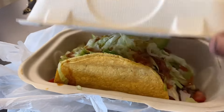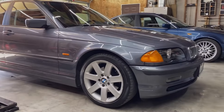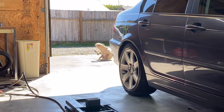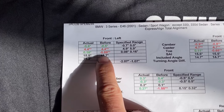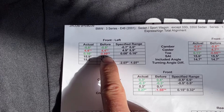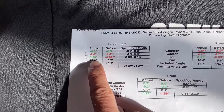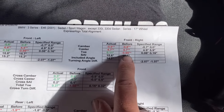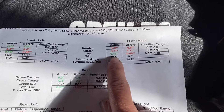This thing's driving better already, and I nailed counting the threads because the steering wheel is perfectly straight. We're still going to get it aligned though. $115 later, we are aligned and she is driving so nice. Toe on the front left before: negative 0.9 degrees out, brought back to positive 0.16. Front right: negative 0.65 degrees out, brought back to positive 0.11.